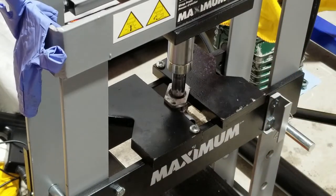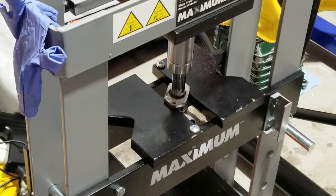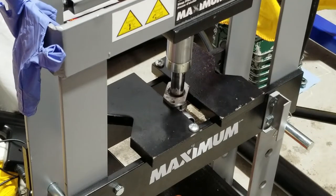Okay, got the piston out, whole assembly out. I'm trying to keep it in the same orientation so I can take notes and put it exactly the same way that I got it out. I find that there's no need to press a complete assembly apart, as I already got at the moving parts, so I achieved what I wanted to achieve. I cleaned the inside, I cleaned the parts that are going inside there, and now I just gotta clean the case, and that's about it. So I'm gonna take that out and we'll take it to the parts washer again.